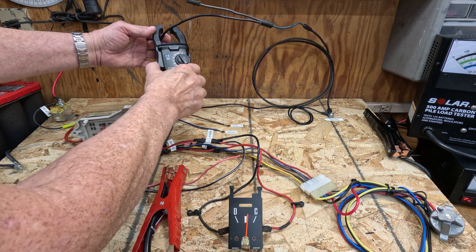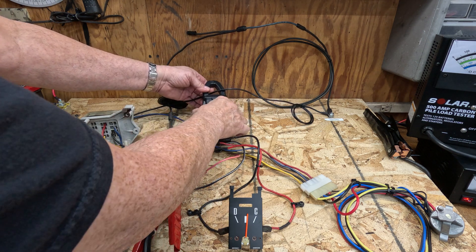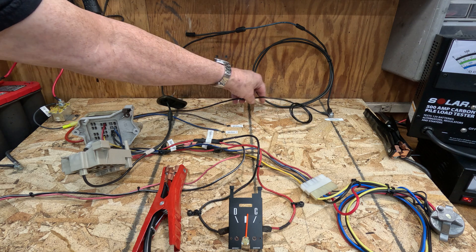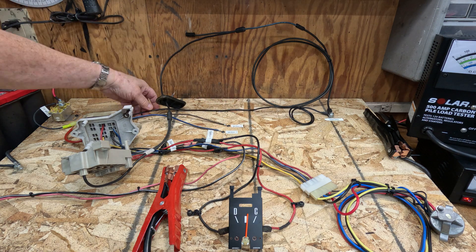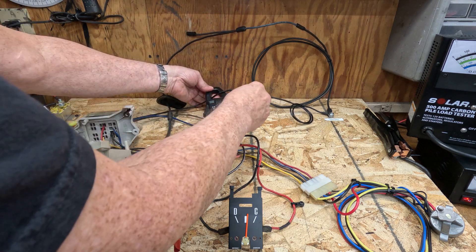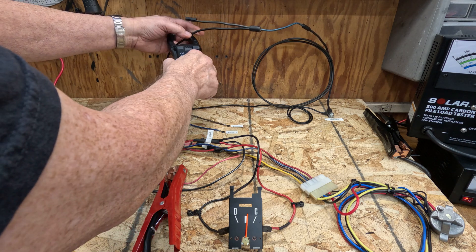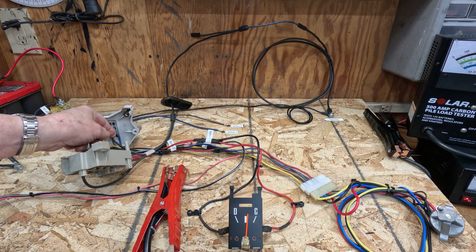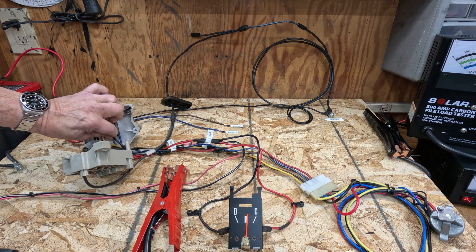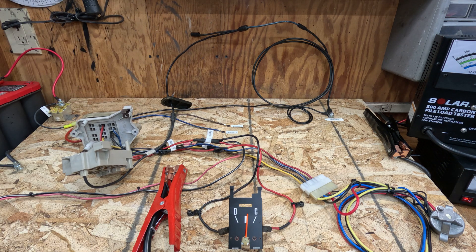12 amps through the bypass and another 11 amps through the original path. So now we've dropped — 24 amp-hours excuse me — we've reduced our current across the original charge path. 13 amps on one side, another 12 through the bypass. Our connection here at the Packard — it's cooled off significantly. That's how this bypass was supposed to work.